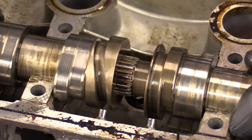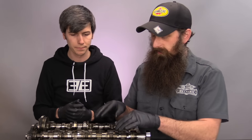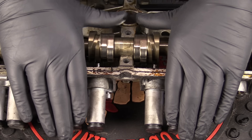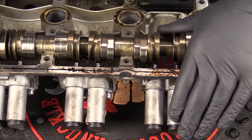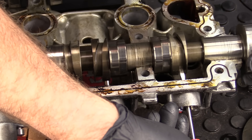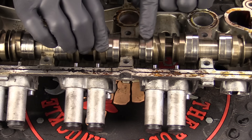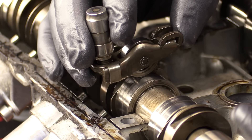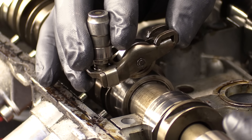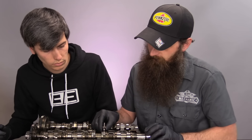These are essentially sleeves that are splined to the camshaft. We have two solenoids that control this sleeve — one solenoid will pull it one way, the other will pull it the other way. When the solenoid is activated, the pintle will come down and ride in this channel, sliding that sleeve over to change the profile of the camshaft that the rocker is riding on. So from high lift, one solenoid activates and pulls it over to low lift, and the other solenoid pulls it back to high lift.